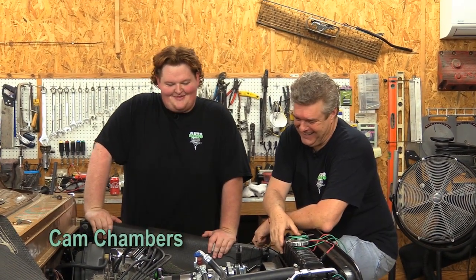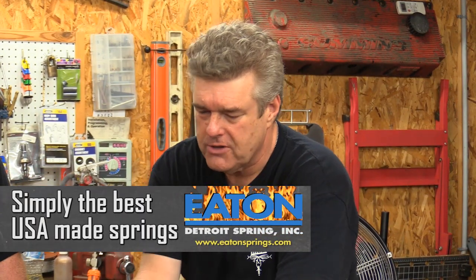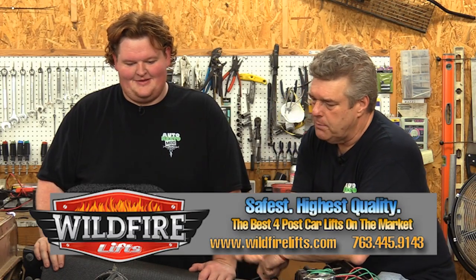You were wrong. Yes. Why are we taking things apart that were once together? Because you were wrong. We were both wrong. Well, yeah, because I agreed with you. I thought the carburetor was the issue. The carburetor was not the issue. The accelerator pump was checkered, so I replaced the accelerator pump with one from National Parts Depot. Didn't fix it. No, the problem was still there.